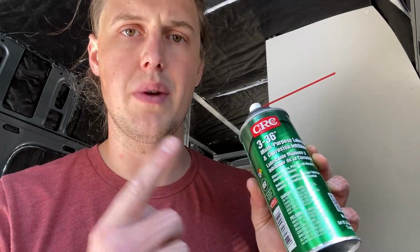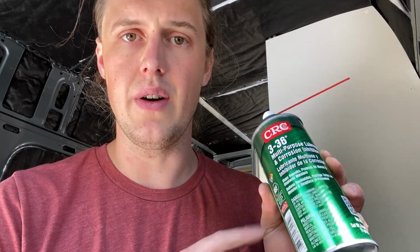Since this is the only hole in the entire van that we're gonna drill and not put paint on afterwards, I wanna make sure that we're not gonna get any rust over time or any sort of corrosion. We're gonna spray this stuff on it right here. It's actually meant for electrical components and preventing corrosion in the long run. You can find this at your local hardware store, but I'll also put a link to it in the description below.